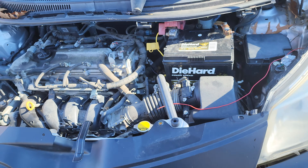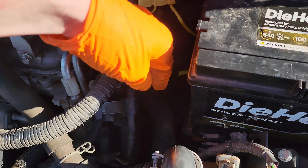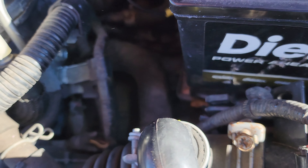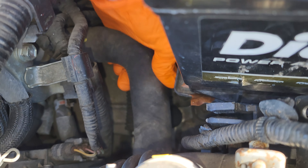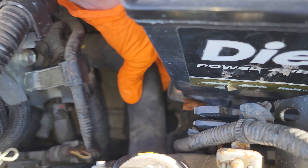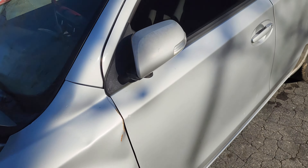So let's go check it out. I'm gonna go ahead and fire it up. One thing I like to do is see how quickly the cooling system builds pressure. Right now you can see on the upper radiator hose I can squeeze it — it's pretty pliable. Obviously there's no pressure there because the engine is off, the engine is cool.